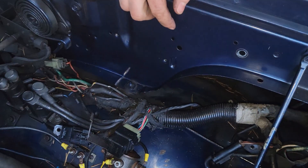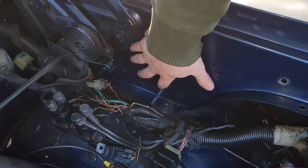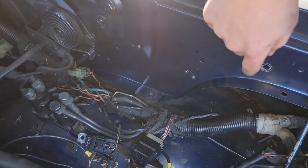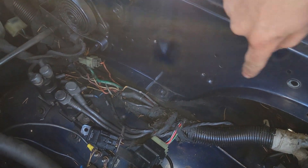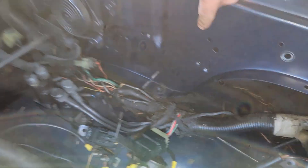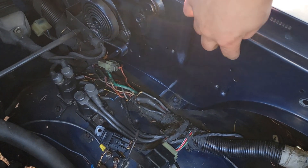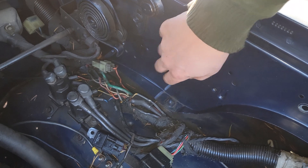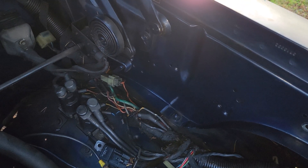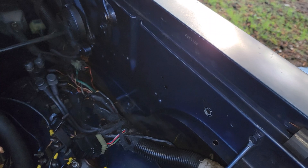I've come into the driver's side of the engine bay. I've removed a couple of relays that were here as well as the horn for now, and I'm going to arrange my systems here. The plan is: battery positive to the circuit breaker, circuit breaker to the positive bus bar — this lets me disconnect everything with the push of the circuit breaker — then bus bar to the split fuse block, and a wire over to the solenoid to provide switched power for one bank of the fuse block. I found a good arrangement and will mount everything to the inner fender.